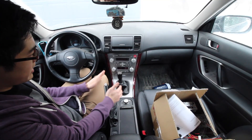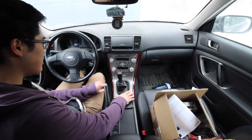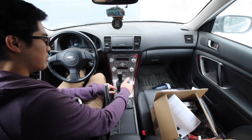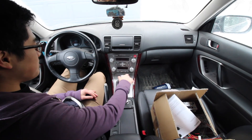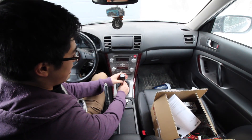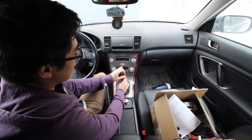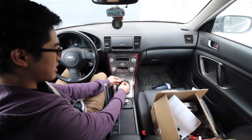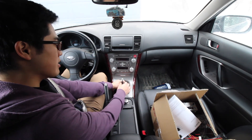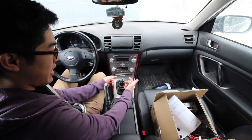So now that we're in the car, we're going to take out the original factory stereo system. The first thing you want to do is remove this middle shifter area panel. With a manual, it's a little bit different from the automatic, because the automatic has the shift lever but it's all a solid piece. With the manual transmission, first take off your shift knob. If you have the factory knob, it'll screw off but then keep spinning because it's attached to the boot itself. So grab the top portion of the boot and the shift knob and kind of pry it apart — it's seated in there with a plastic ring, so it's not on super tight.